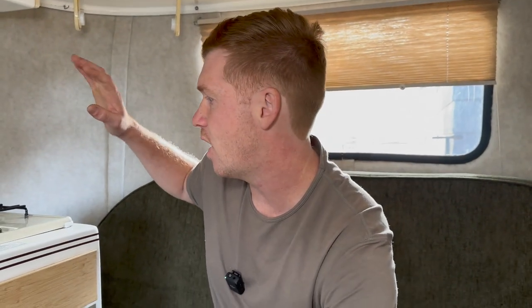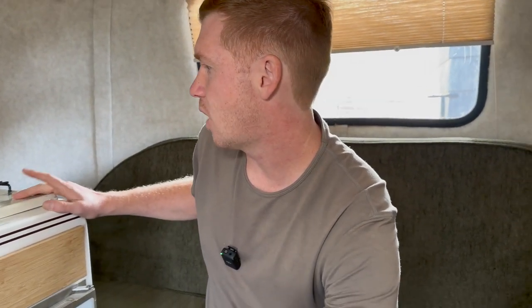When I first picked up the Scamp, it didn't really have an electrical system. Someone had taken out the battery and nothing was hooked up to electrical. So basically the only things being used appliance-wise were things that ran off propane, which were the stove and the fridge. And actually the heater didn't even work because it has an electrical ignition.